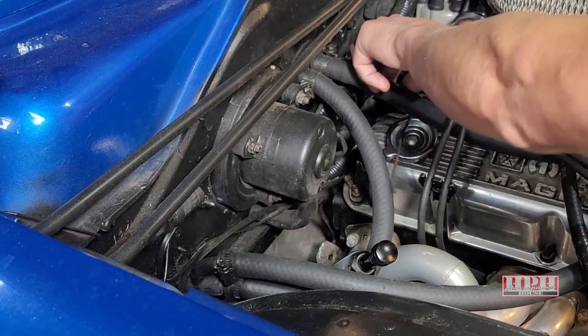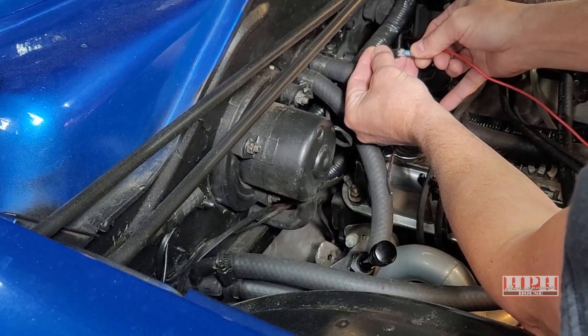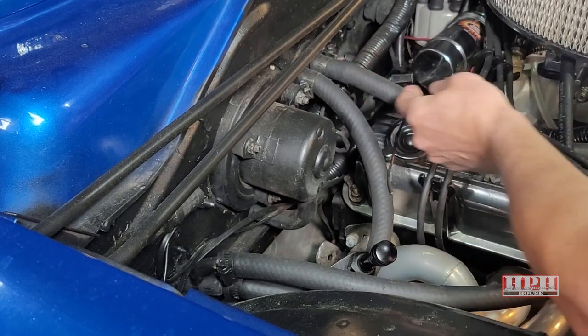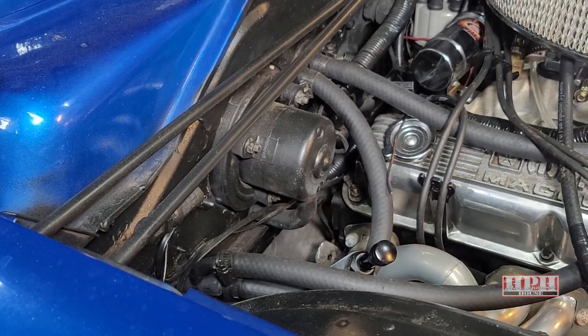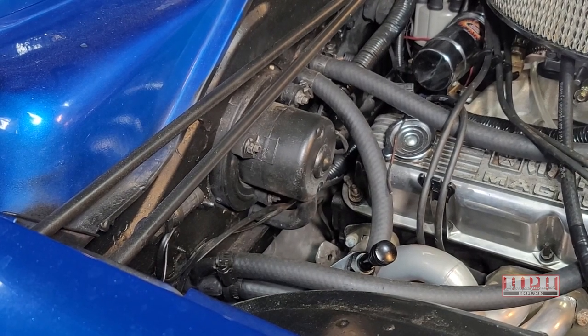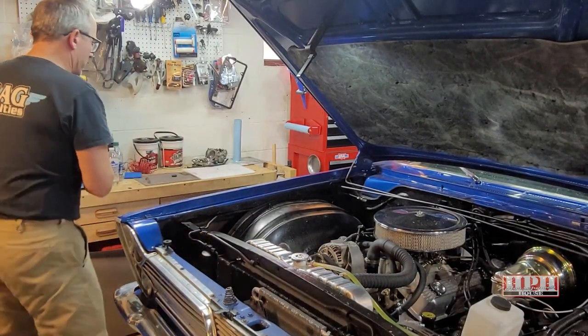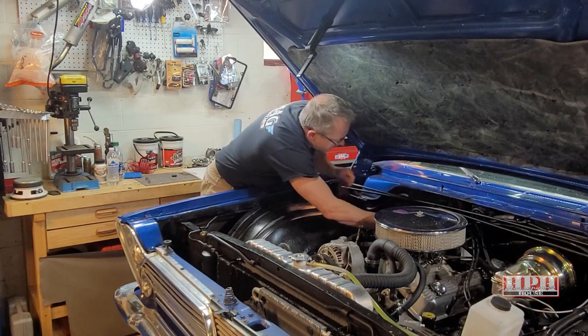Listen closely. Let's see what happens when we connect this. Definitely works. That's a good sign because on some cars, swapping out that blower is not easy. Even though it looks like it's easy to access, on this car it is not easy to swap out. So that's a good sign if you at least know your fan is working. Now we can go inside the car and try the wiring that tells the blower fan what to do, and see if we can get some power to that. Don't forget to put your blower back together as far as the fan connection.